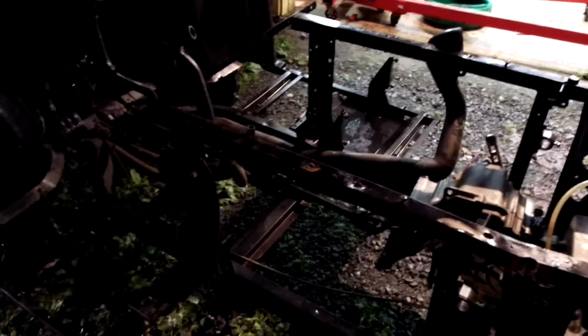This thing takes about ten bolts to take the whole thing apart no matter what you touch. The previous guys, when they started adding things back, added about fifteen different bolt and nut sizes. They used carriage bolts for the hinge, and for the bed hinge they had a little angle iron made out of scrap steel like a spring shackle holding it back — because this part of the frame right here is bent so much where the cab was that it shifted back, so instead of fixing it correctly they just put a shackle back there that caused the bed to be angled.